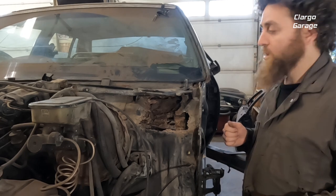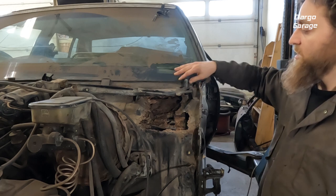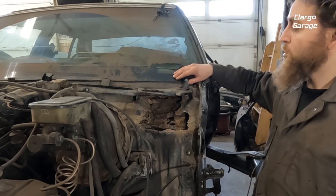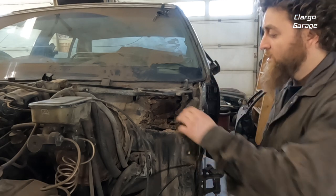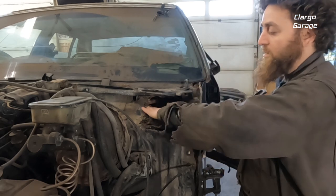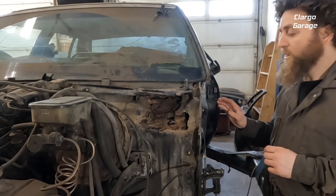I'm going to have to go underneath the windshield. I'm planning on pulling it, but not yet — I'm going to try to set myself up to have fresh metal there, at least enough to weld to. So when I do pull the windshield, hopefully next winter, I'll be able to get all that fixed and already have good metal without making more work for myself. I still need to finish cleaning everything up to decide where I'm going to cut to, and then make some templates before I tear it all out.